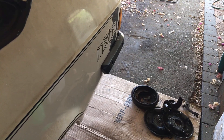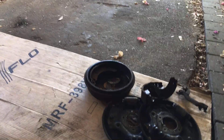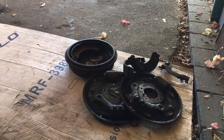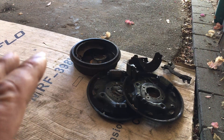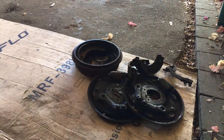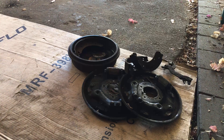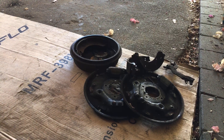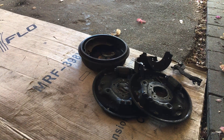This is not so much a how-to as more of a 'what I did.' First of all, what don't you need? Well, there it is — you don't need any of that. Once you've got the car up on axle stands, remove the road wheel and start dismantling. Get rid of all of that — the drums, the backing plates, the shoes — it's all got to go. Same with the handbrake assembly, because the one that comes with the kit is completely different. Once you've got the half shafts out, that's when you can take those backing plates off.